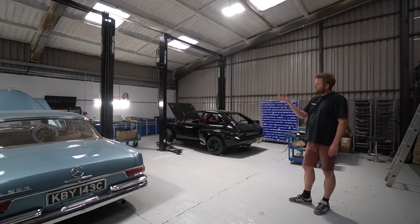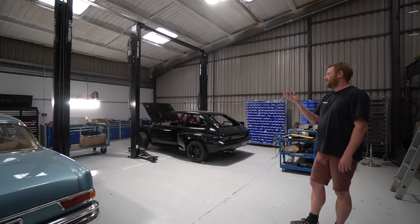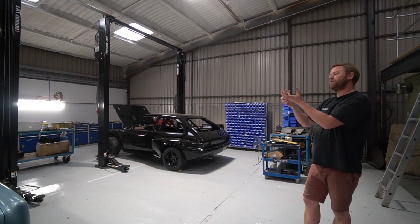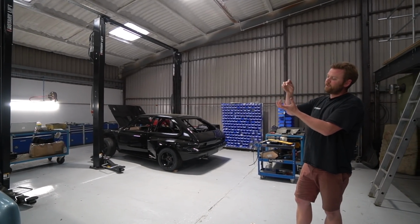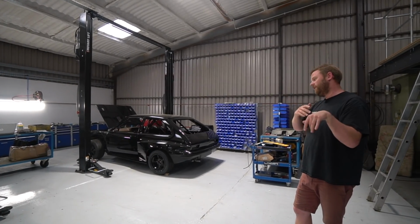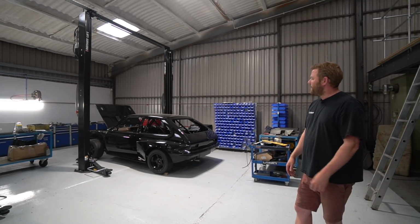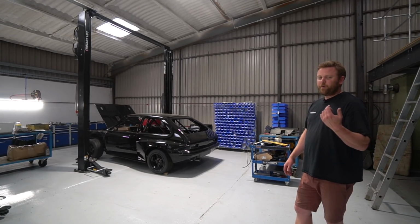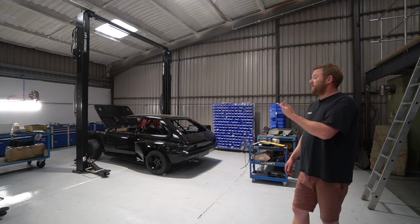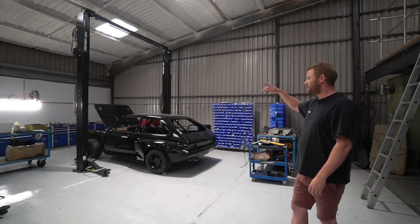And then we've got essentially a dropped pot in the middle. You might call it a swirl pot, but it's basically an anti-surge tank in the fuel tank itself. So there's a round pot extending from the bottom, which is only linked through to the main tank via a few small holes. So the fuel fills that, but can't easily slosh out of that during cornering, braking, acceleration, etc. And that's where the output to the fuel pump is, and the return from the fuel rail goes straight into the pot, so it's always continuously filling that pot as well.